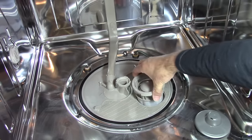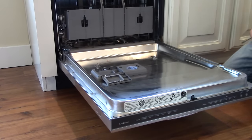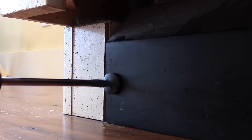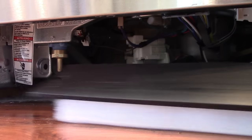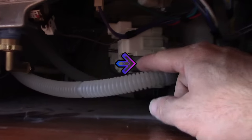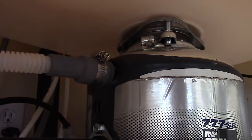Now if you still didn't find any problem there, then you need to check your drain pump. We're not going to replace the drain pump in this video, but I'll show you where it is and what to look for. You can take the cover off by taking out the left and right screws — a little half turn and then pull it out. When you take the cover off, you can see the drain pump. Right in front of it is this corrugated clear hose, and that leads right to your garbage disposal. When your drain pump goes on, it pumps the water out through this hose and empties into your sink.